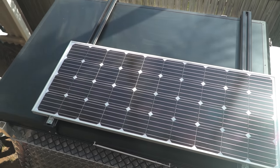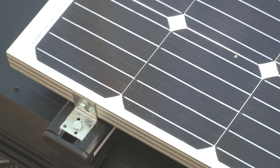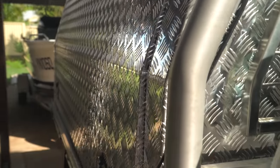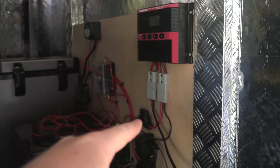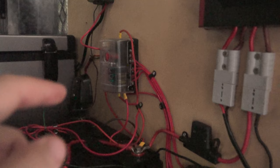Solar panels are on. Roof racks are on, secured with our little makeshift brackets, which work pretty well — I'm happy with that. I've just got the solar panel plugged in up there, running down to Anderson plugs and then a little extension in through the door. I'm not sure where everything's going to sit yet, so I'm just running it in through the door for now. This is our MPPT, which goes one side to the battery and one out to the solar panel. We've got our fuse box here for running all the sockets. I want to turn these the other way so the cords all come out nice and neat and don't flop over each other.